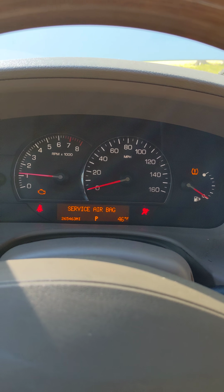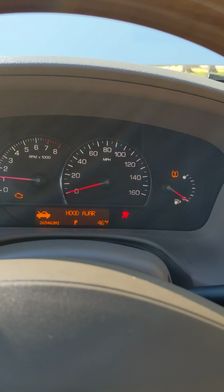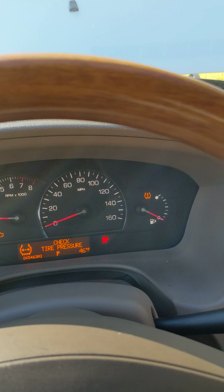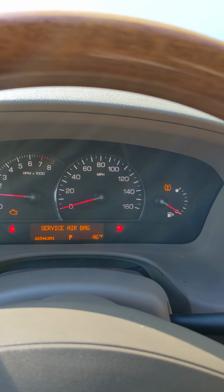So I checked the fuses and the relays. I switched them around. I was still getting nothing for still 30 minutes. That was the first thing I did. You can see a battery charger there. Just the simple stuff. I always check that first. Even though I know the battery was fine, still, why not, right?